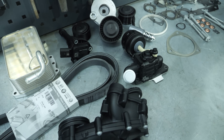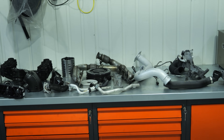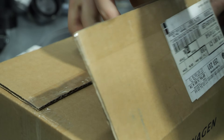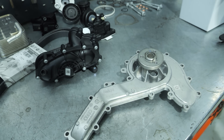The most expensive and, at the same time, most important attachments that need to be replaced are: the oil cooler, the oil pressure control valve, the oil level sensor, the coolant pump, the coolant regulator, and the valve. We fit accessory components to the new engine that we have previously cleaned and checked.